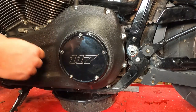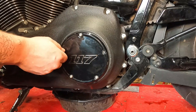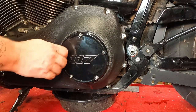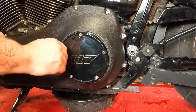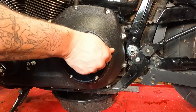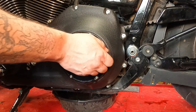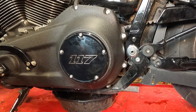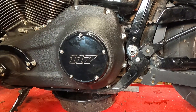On some years, especially the air-cooled Sportster years, Evo air-cooled Sportster, it was easy to tilt this to the side, then the gasket would get pinched, then they would leak. Then you have to fix it on your wife's bike on the side of a hill in Black Mountain Harley, somewhere in North Carolina in the middle of a trip. Luckily, the people there were very nice.